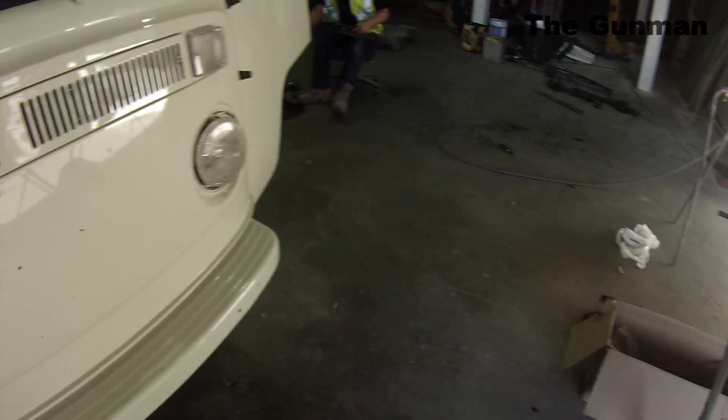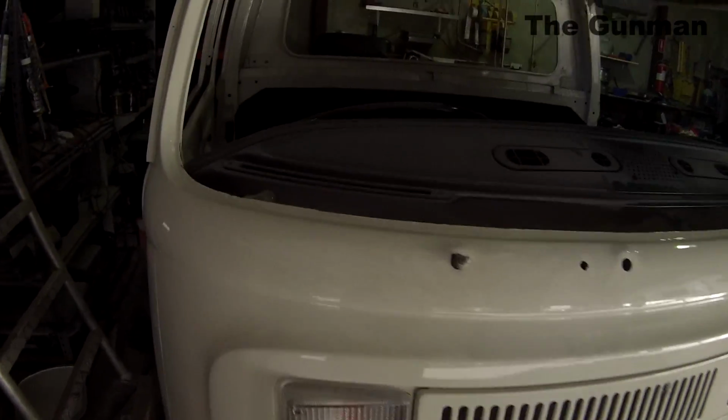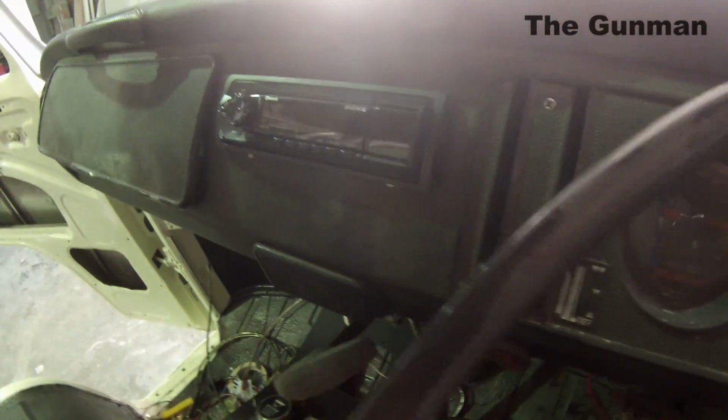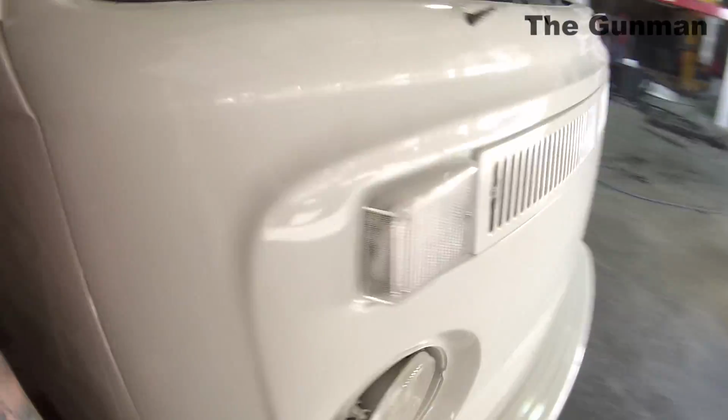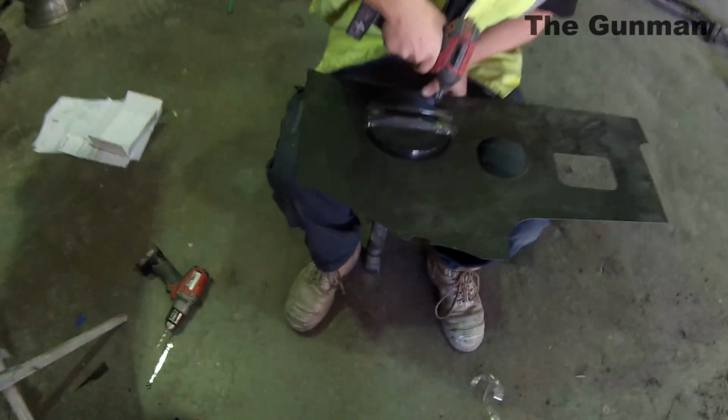So yeah, next up we've gone and put a few parts on here and there. And one thing I can tell you, if you're ever to take a job like this on, my uncle had a restoration shop, and one thing he always told me was, especially when doing an old car like this in restoration, there's no use in putting a part back on that's dirty or not polished. So every single door handle, every single trim, wiper blades, all of that, like little rubbers, get a thinner's rag onto your rubbers and clean them right up.